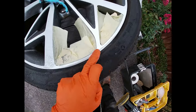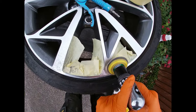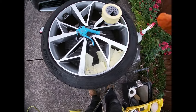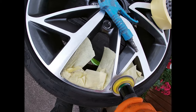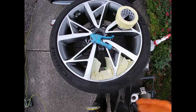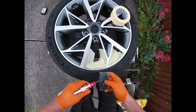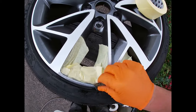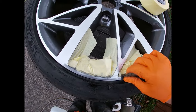320 — we're just going to go over it again. Then 400, over it again. Then 600, wet and dry — let's wet the sanding paper. Remember to keep it as small and as localised as you can. I'm just smoothing out that finish.